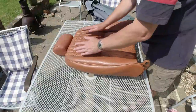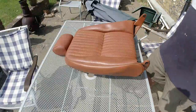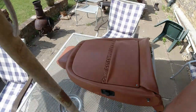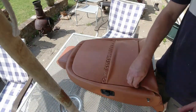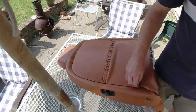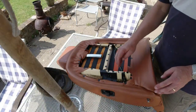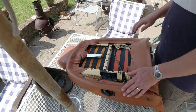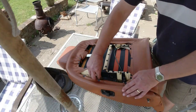What I'm doing here is showing you how the centre foams behind the basket weave rarely suffer this problem, because they're a completely different type of foam — the bits down either side just disintegrate. Getting the seat back off is a piece of cake. There's two screws you can see, and also two little screws that are just underneath the frilly bit at the top of the seat pocket. Don't forget those — you won't be able to remove it without them.